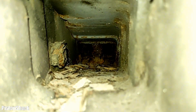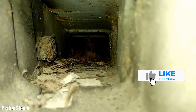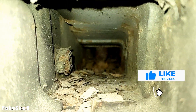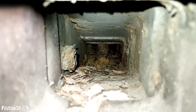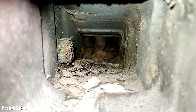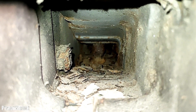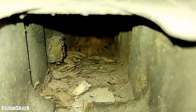As you can see, the metal is flaking, paint is peeling, we have lots of rust, and that will end the life of that part of the frame and make your vehicle not safe to drive. By the way, if you go to buy another L400 Delica, that's the first thing you have to check — check the condition of the front part of the frame, especially the lower part, or get a good deal and buy the vehicle cheap.